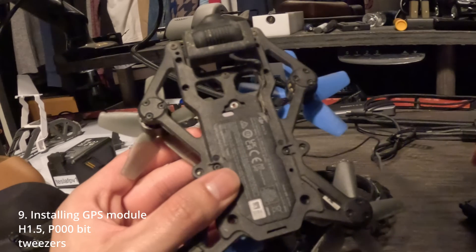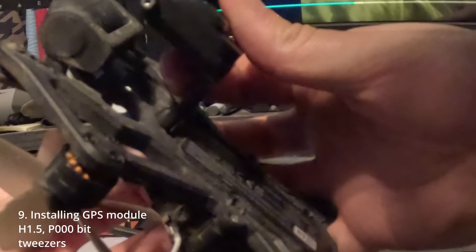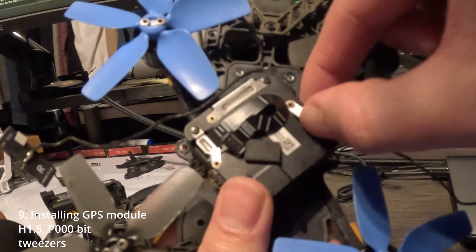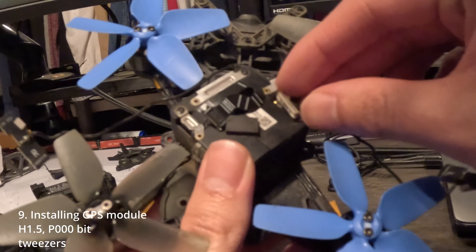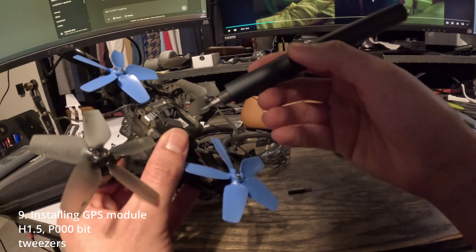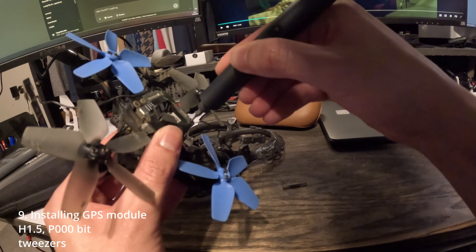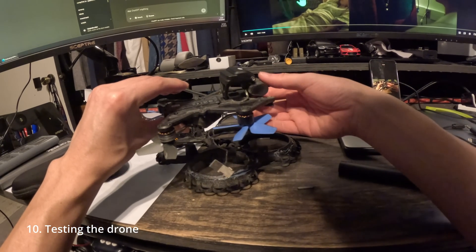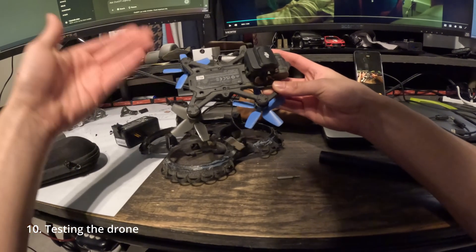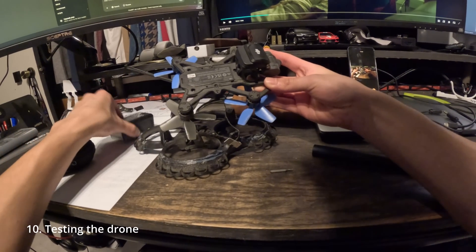My part came in. Let's go ahead and fish it through this small hole right here, out the way it came. We've gone ahead and pushed it through — let's pull the cable all the way through and then we are going to set it in place. Now that it's all the way through, I'm going to go ahead and screw in that middle screw — that's the only thing holding it in place. From there we can go ahead and pull back that metal tab, place that connector back on, and then slide this back over. Secure it with the Phillips head screw holding it down into place nice and tight. From there let's go ahead and turn on the drone and just test it — no flying. If you don't feel comfortable, take off the propellers. We're going to test the motors and everything, so that's what I'm going to do — take off the propellers and then plug the battery in.